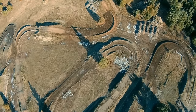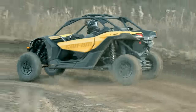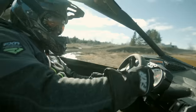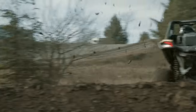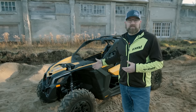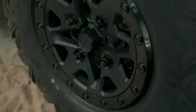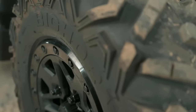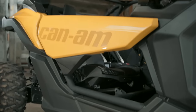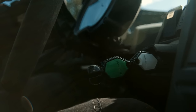The X3 XDS package is 64 inches wide, pretty standard for a pure sport side-by-side. The width helps make it more stable, but much of its predictable handling characteristics come from its four-link rear end's nearly scrub-free operation, excellent sway control both front and rear, and its extremely precise short ratio tri-mode power steering system. There simply isn't enough time in one test ride to go over all the exciting new technology and design elements that make this vehicle so special, but a few secondary features are worth noting. 14-inch aluminum beadlock wheels and 29-inch Maxxis Bighorns are a great combo. Trick LED lighting adds to the X3's overall futuristic feel, and semi-half doors keep you in and most debris out. Multiple drive modes and a throttle-limiting learn key help keep the incredibly powerful X3 controllable in any situation, even for newer drivers.